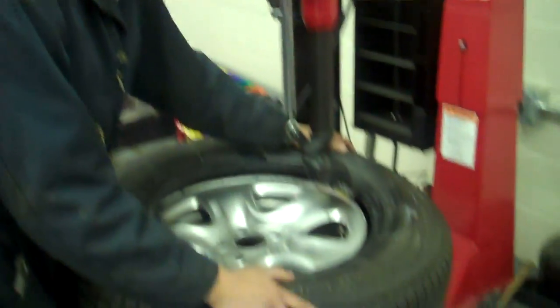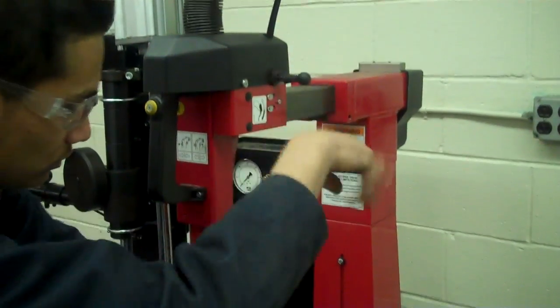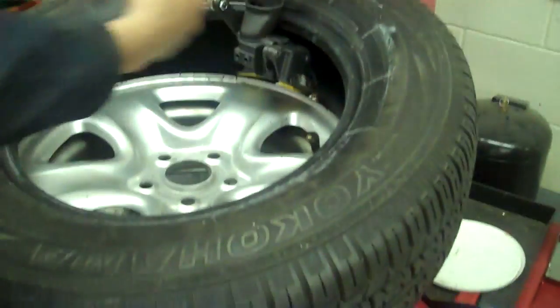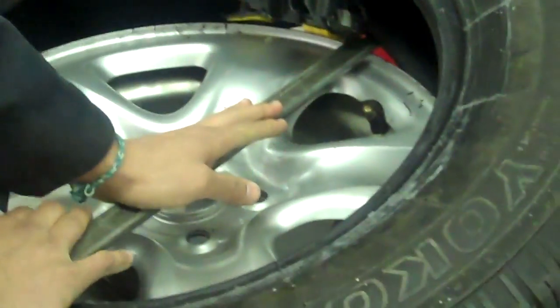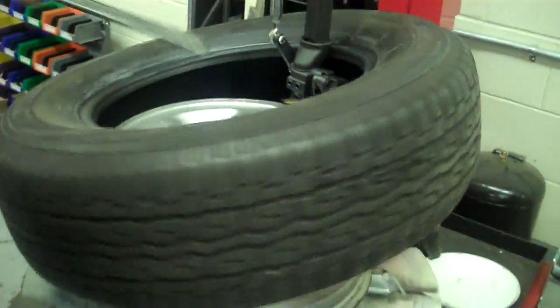The top of the tire is now taken off the rim. I'm going to take off the bottom. I'm going to lift this up and flip this switch down, then pull the tire over the duckbill and pull that up just like that. Take the tire iron again, put it right under here again. Use both hands and hold it down tightly. There we go — easy as that.